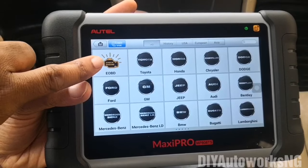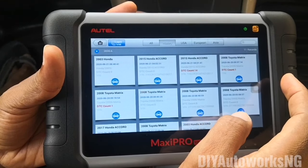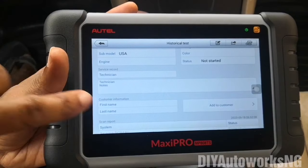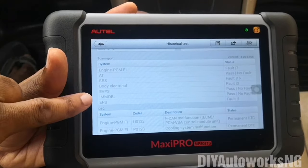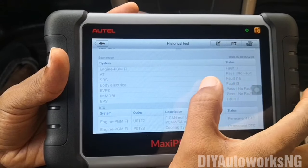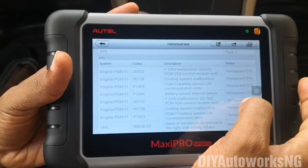Something I didn't cover — EOBD — that's right here. Let's look at what a full scan looks like. Going to history, I scanned a 2017 Accord. So basically it runs through all the modules the car has: engine, automatic transmission, and so on, then gives you a summary of all the codes. As you can see the SRS had 16 codes, and then beneath that it starts giving you the details. On the engine it had all these codes and it also tells you the status — some of these are permanent codes while some are temporary.